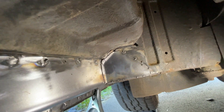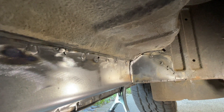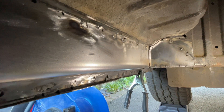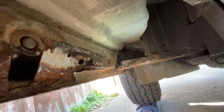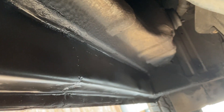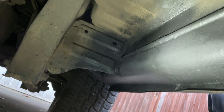I've got the first few welds in on this one and everything's starting to feel really nice and secure. I've been using quite a lot of plug welding, which is where you drill a hole and then weld through it. Here's what they look like before - a complete rusty horror show - and now I've painted them all and they look pretty good. I'm a complete amateur; this is the first time I've ever welded and it's actually come out better than expected.